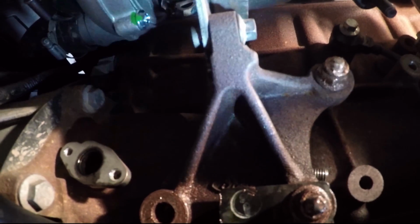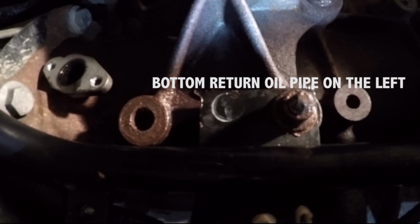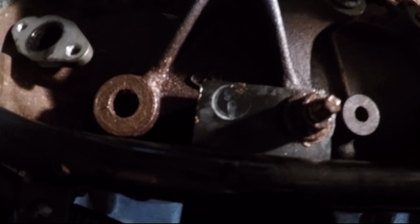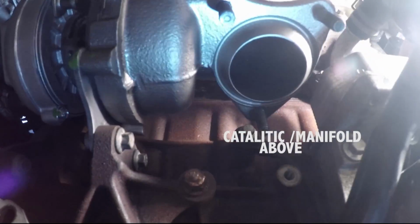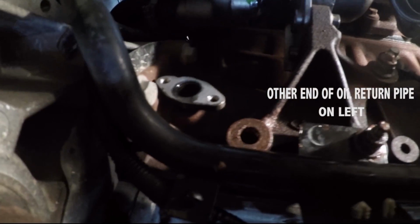Right, I'm underneath the car. I've got the turbo in place. There's two bolts there and there. This is the bracket that holds it on. I loosened that off. I didn't actually take it off, I just loosened it so it allowed some play. And when I got both bolts loosely in, I put the exhaust clamp on, which is up there. I'll show it to you from the top. And it's more or less in place now. It's just putting everything on it.